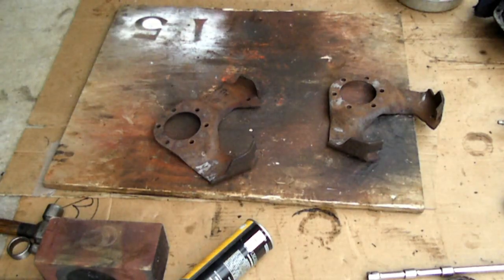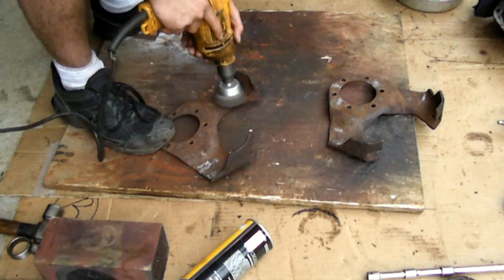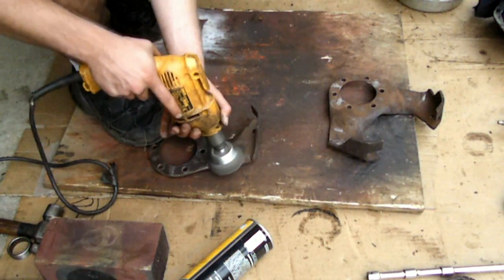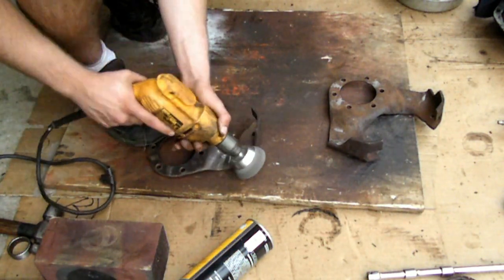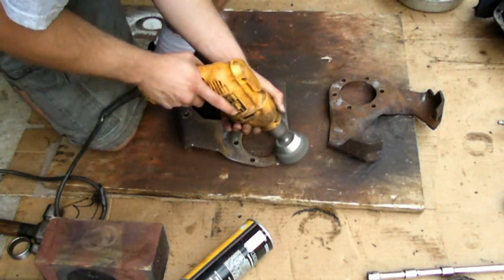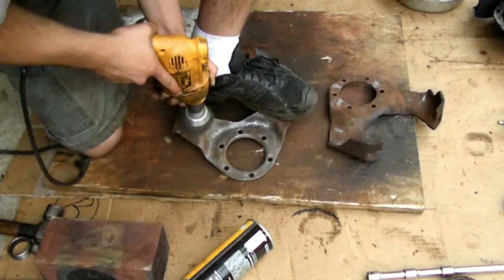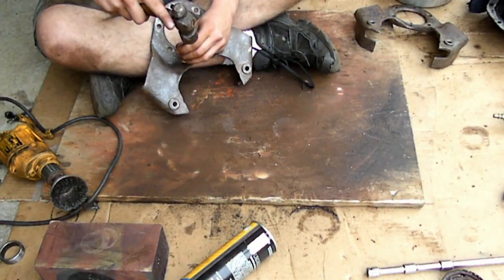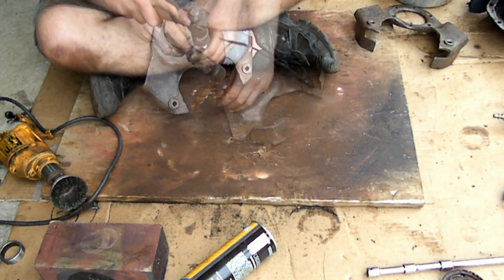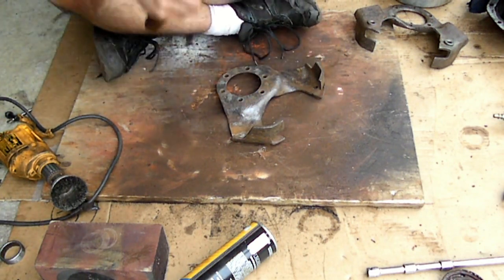And that's that. The last step of this day was to wire wheel the caliper brackets. They were in pretty rough shape, so it actually took some doing to do right. Because they were really crusty, I also took a cold chisel and a hammer and hit all of the extra chunks of rust that were left behind. This will, in the end, make them look a lot better, and there were a lot of them, so it'll be worth it.